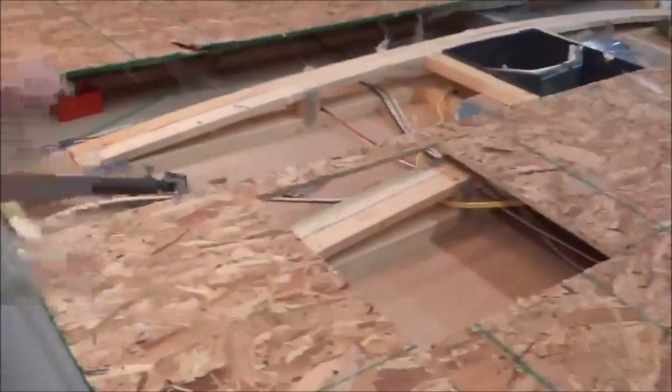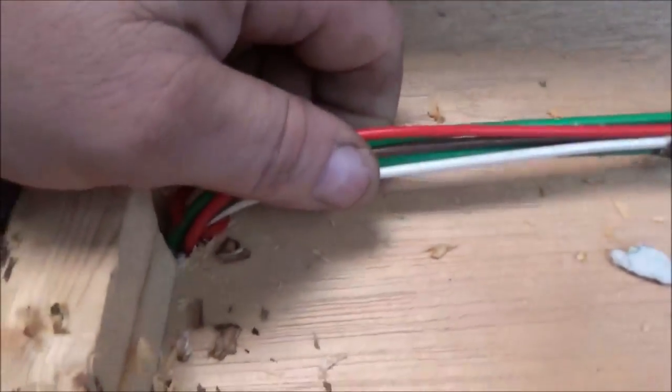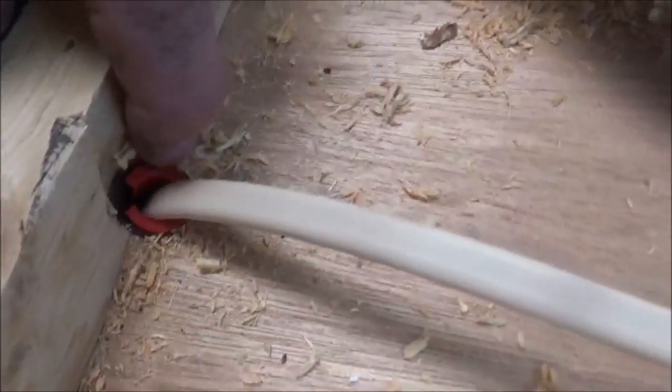Back on the Freedom Spirit — we've got a mess going on here. What we've done is loosened up the decking to find the wires we were talking about — the electrical running down, remember the ferrules I was showing you. We put bushings in here and went along and did every single one of them on both sides to make sure. So now we've got the deck up.